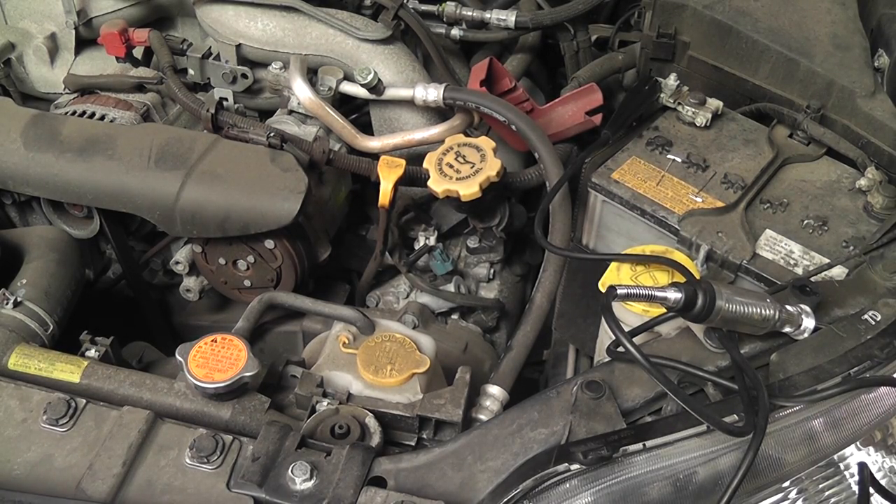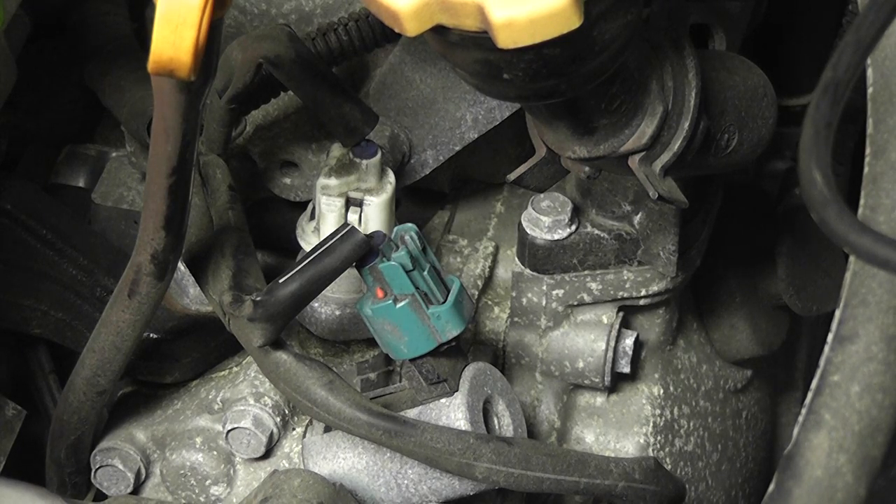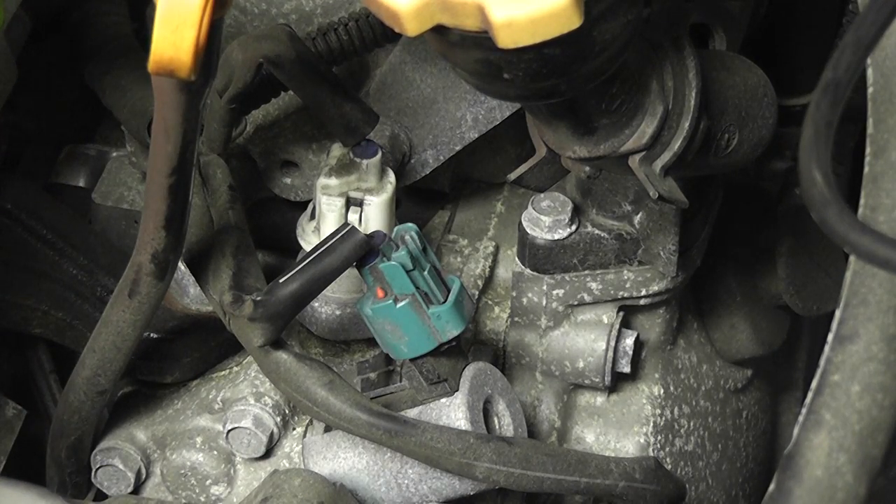The next part of this video is circuit identification — how do you know what you're dealing with? This is some type of VTEC system. I'm not familiar with the mechanics behind it, but I do know the electronics. They're using a two-wire solenoid with the light blue connector — a two-pin hydraulic solenoid that controls oil to a mechanism. Just above that, the white plug is an oil pressure switch. Different terminology for this Subaru, same concept as Honda. We have a switch and a solenoid, and first we need to identify circuit design.